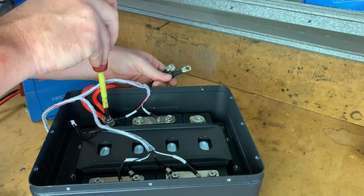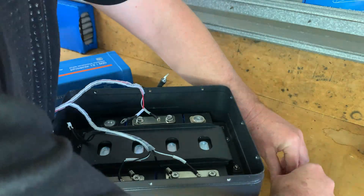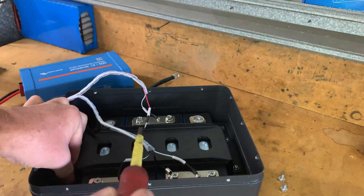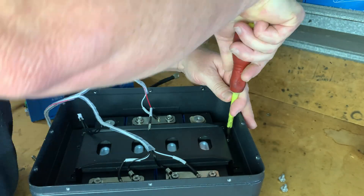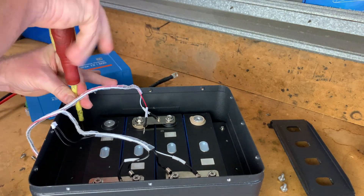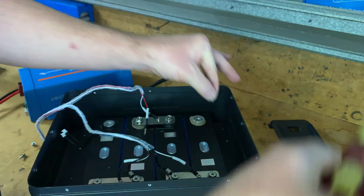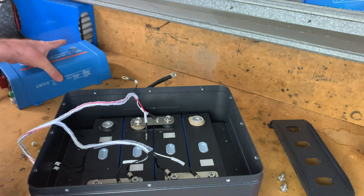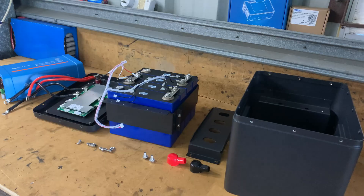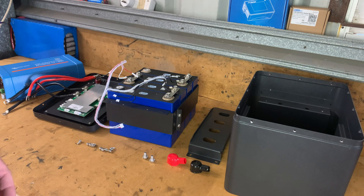The battery has an eight-year warranty with maintenance free 4,000 cycles at 80% DoD. The battery management system has hardware and software protection for charge, discharge, and temperature — including overcharge and discharge cutoff, high and low temperature cutoff, with a built-in auto cell balancer. It has a maximum charge current of up to 75 amps and a continuous discharge current of 100 amps. It uses A grade cells, all fully tested to UL 1642 standards, all housed in a non-flammable black metal carry case.